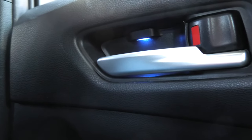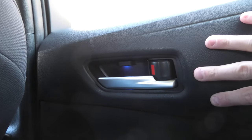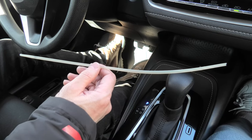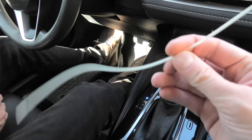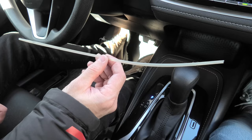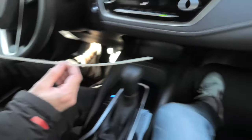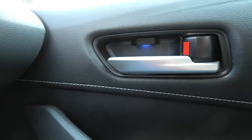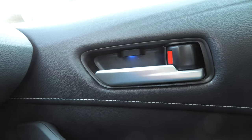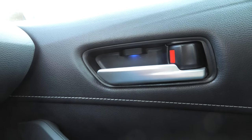One more thing to point out: when we were doing the installation in the back, we actually didn't have to use a zip tie — we managed to just push the wires through, because there is not as much insulation in the back doors as in the front ones. Also, when you use a zip tie, it is a good idea to use one that is not as thick, because it will be easier to pull the wire and connector through. That is pretty much it for the installation. Thank you guys for watching — I will leave the link in the description, and we will see you in the next video.